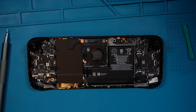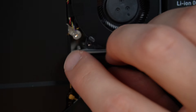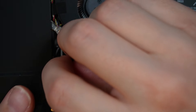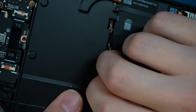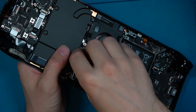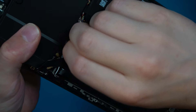If you want to clean up any areas where the white pick left a mark you can do that. The next thing the guide says is we need to disconnect the battery. If I zoom in a little bit more — there's a little tab here. It says just pull it directly away and that should pull the battery connector out. It doesn't seem to want to come out straight away though, so we're going to keep wobbling it and eventually — there we go, it's out.